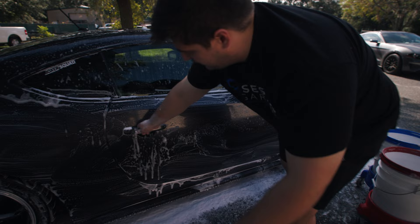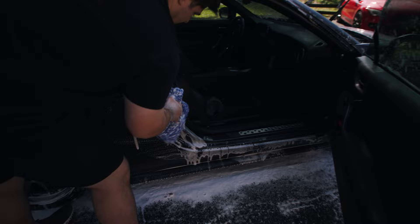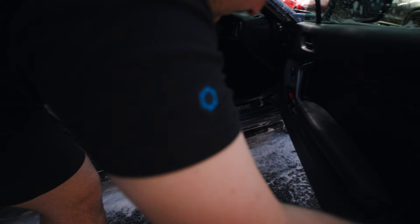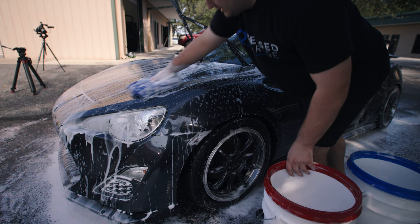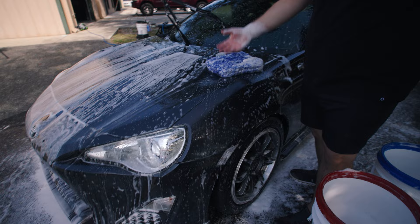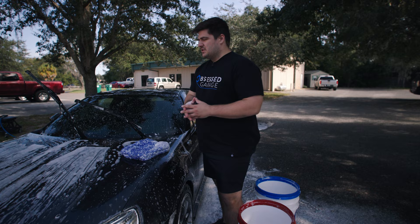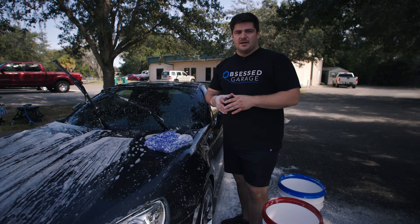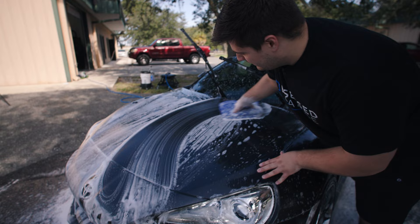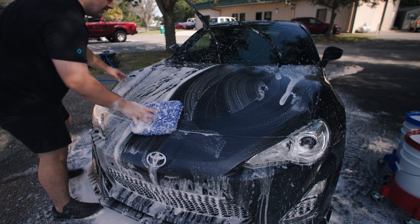While we're here, we're going to pop the car door open and hit our door jams. You don't have to worry about getting water or soap in the car — all of that's going to get blown out whenever we do our final rinse. This is a baseline demonstration of how we wash a car; you can adapt it to whatever works best for you. If your car isn't very dirty, you might not have to revisit the rinse bucket as much. On the other hand, if it's incredibly dirty, you might even refill halfway through. As long as you're being safe and using quality products and quality wash media, you'll be fine.